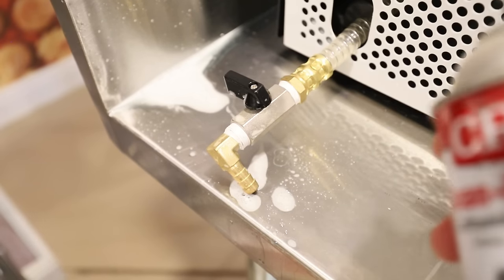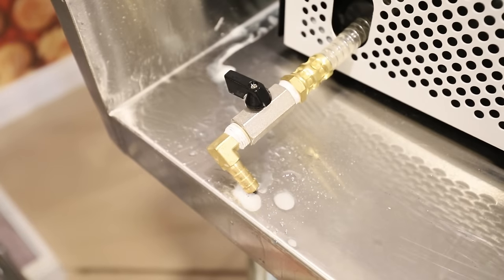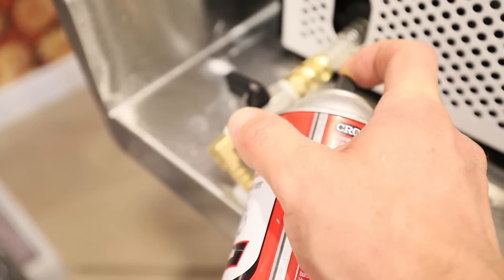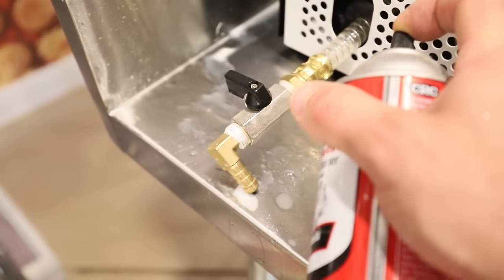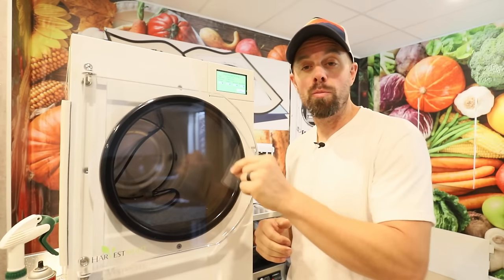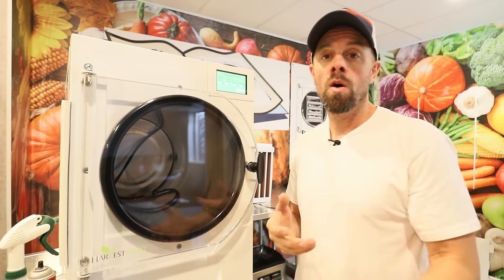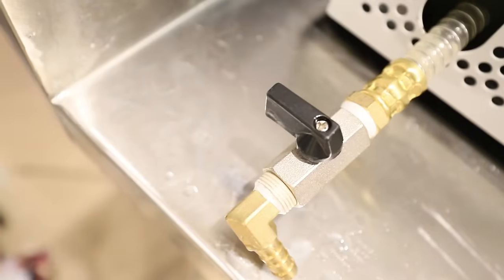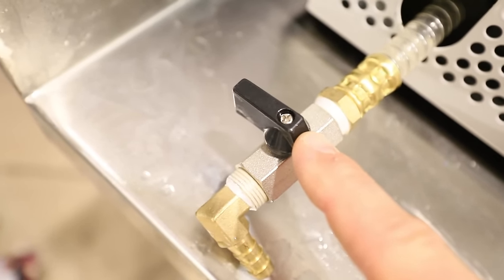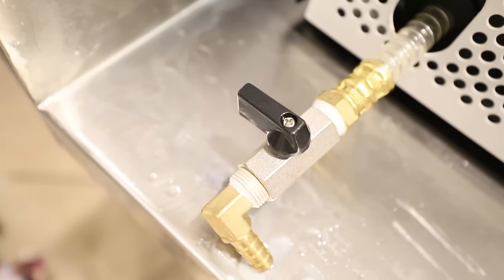That means you're going to want to check this black little fitting right here, and then check your mTorr, and then you're also going to want to check this fitting right here, and the Teflon, as well as the crimp. After each area that you pinpoint, make sure you check your mTorr again, because that's going to tell you where the leak potentially is. I've also seen some cases where this little lever can just get loose, so even tightening this thing up can make the difference.